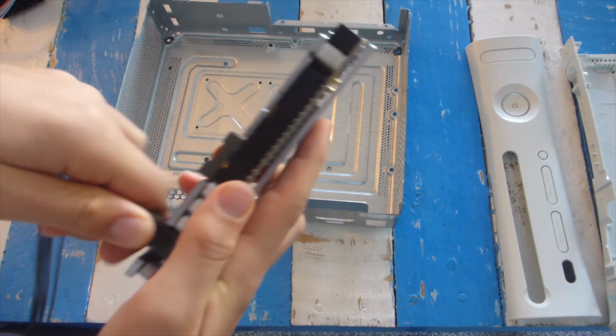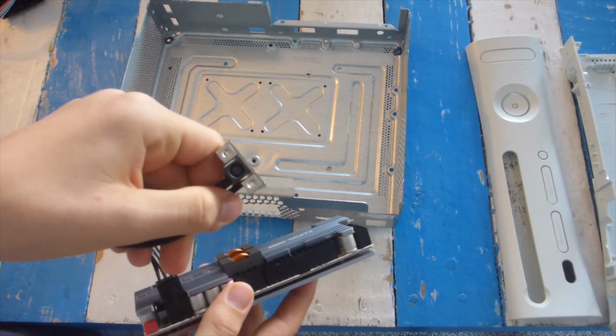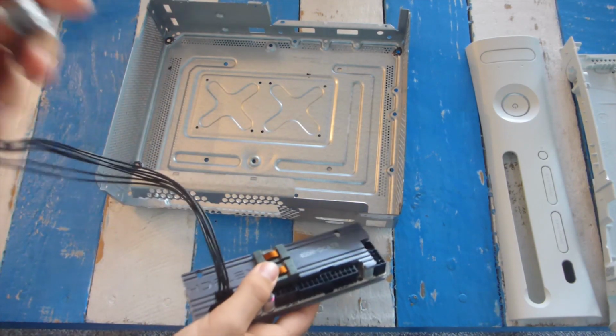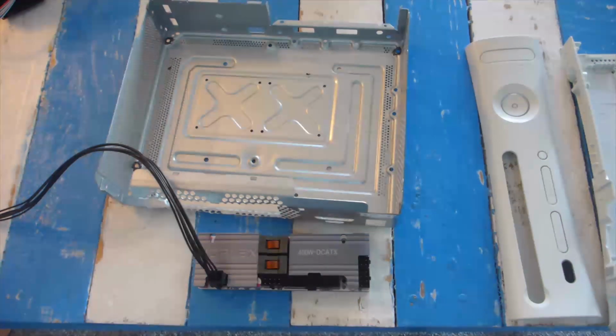And because this power supply uses a laptop power brick, it needs to get power from somewhere, which is where the port comes in. Now this is just a big port in the middle, which is where the laptop power brick comes in, and then also you have two screws on either side. Now I needed to find a place that I could drill these three holes somewhere and make it look presentable, and try to keep it at the eye and preferably on the back of the case.